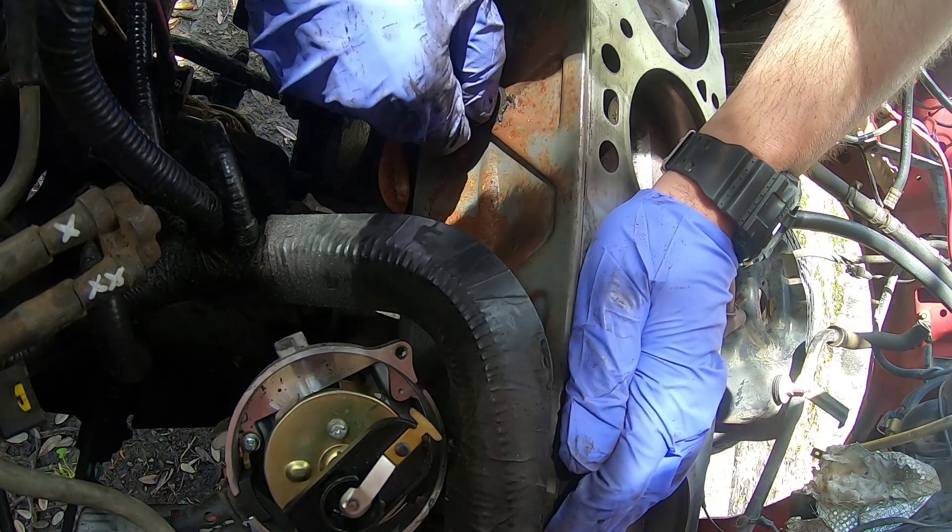We're flipping the view looking towards the cab. Let's get this wiring harness out of the way. Underneath here, this is one bracket to the actual tappet gallery, and there's one more right beside it. That also holds the oil dipstick too. Let's start getting these out of the way — these are half inch also. So I might have told y'all wrong — undoing that one we just did, your oil dipstick goes to that one. And then there's another bracket one at the very back. That should free this bracket out of the way.